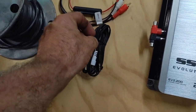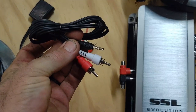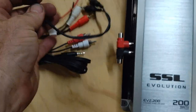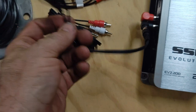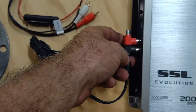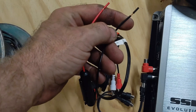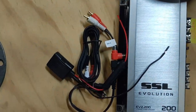This customer wanted Bluetooth, so I'm also going to hook up an RCA cable with an auxiliary cord on it. In order to get these four cords into the amp's two inputs, I'll need a splitter — it's a male end on one end and two female ends on the other. You hook two reds on one side, two whites on the other. This Bluetooth receiver is 12 volts, so you hook the ground along with your amp ground and the power along with the amp power.